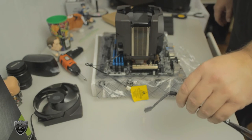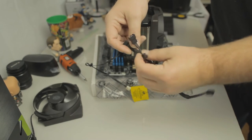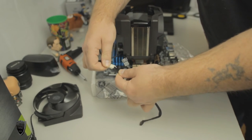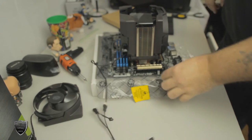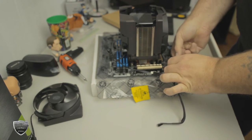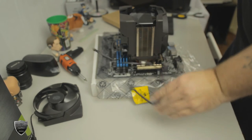This part right here plugs both of your fans in and also the LED light in front of the CPU cooler, so you'll need to have all those plugged in when you install it. In my opinion it's probably best to plug that directly into your fan controller so it's easier to control, but plugging it into your motherboard would be fine as well.